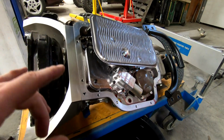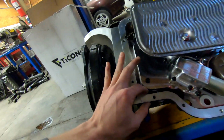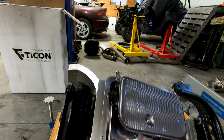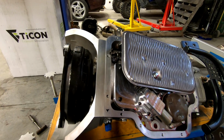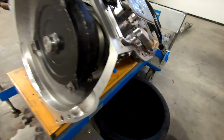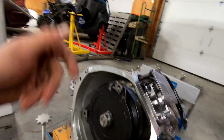I've been texting back and forth with Matt in terms of how we're going to execute the new sealing idea for this thing. And he's actually going to end up bringing his scanner out here, scan the transmission, as the transmission rail, or the pan rail on the transmission rather, is narrower than what it is on the pan itself. So until then, I'm going to go ahead and put the pan back on here, just to prevent any debris or anything from getting into the more sensitive portions of the transmission. And at that point in time, I can flip the transmission over, see about pulling the bell housing off of here, so that I can trim this upper ear. And I'm going to put that back on, and everything will be good with the transmission, aside from getting the pan sealed up. So let's go ahead and do that and see where else we go from there.